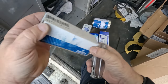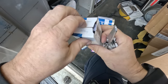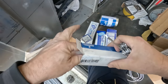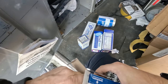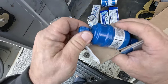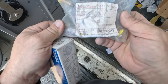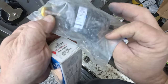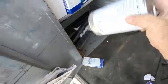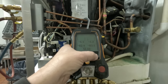I have a dryer here that was for another ice machine — it's three-eighths. It's not often we have Emerson dryers, and it's not very big — there's no desiccant value to it at all. That really scares me that it's not big enough and that it could restrict flow and cause this callback. The one in the Manitowoc is quarter inch, so let's go with the three-eighths. I carry a couple dryers — a little bit of everything — I'm not going to run all over town to get a different brand.